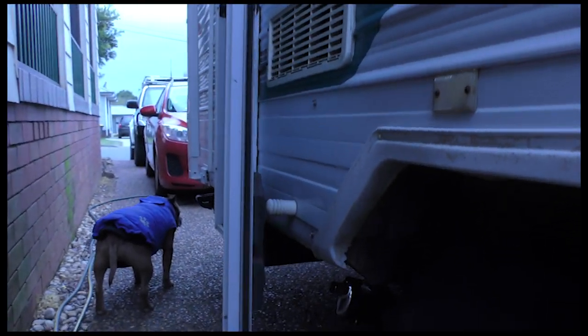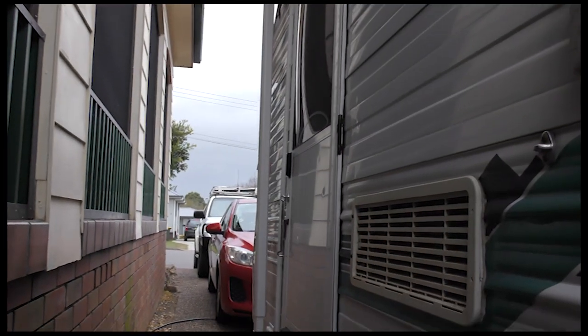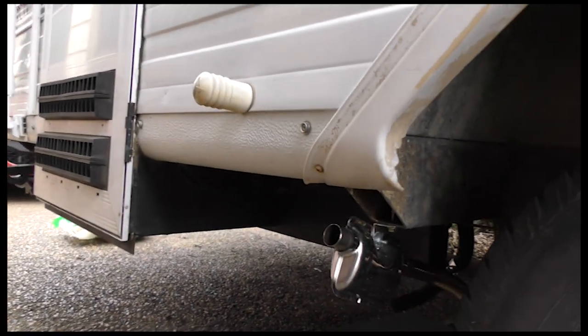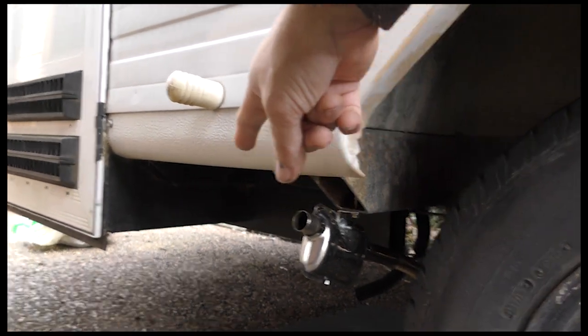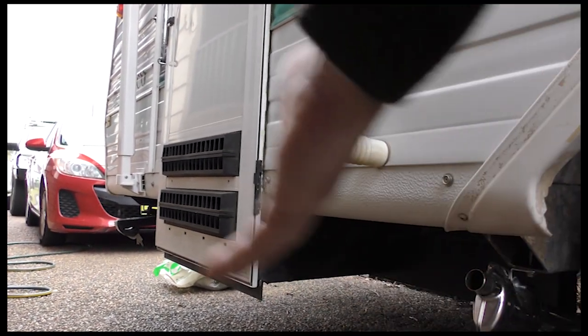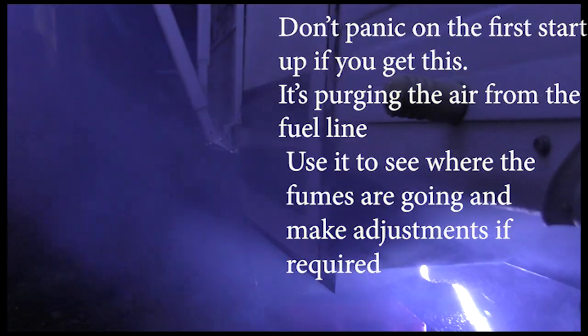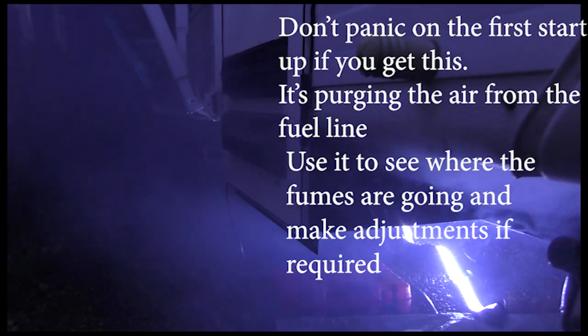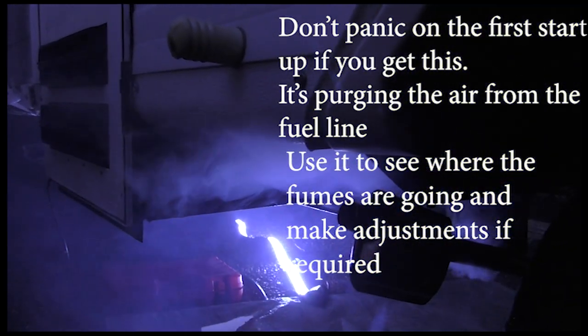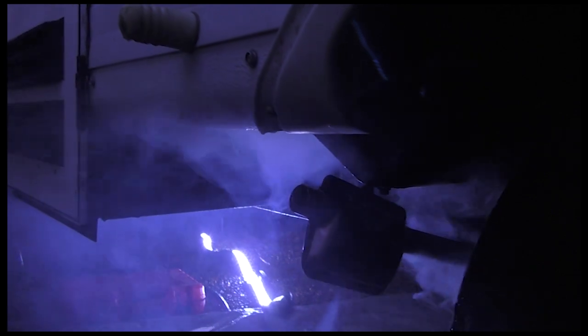On the outside, you can see there is my exhaust air, which is not my ideal situation — this is my door to the outside. If I've got that door open, which is highly unlikely when it's cold and I've got the heater on, you can see we're close to some external vents. So exhaust there, that's the bottom of our door, and if the wind is blowing that way — which I have experienced — the exhaust will come out here, up here, and come straight in the bottom of the door. I may need to direct the exhaust somewhere else, because we don't want that coming straight back in the door. Having the smoke visible is actually a good test — we can see where it's going. That's starting to clear up now so it must be heating up — the glow plug has probably shut off and the heater's actually running inside.